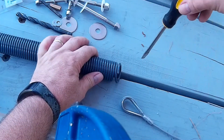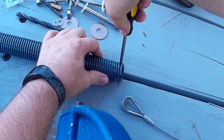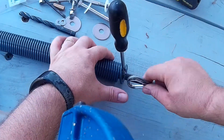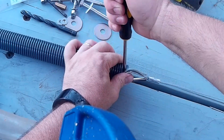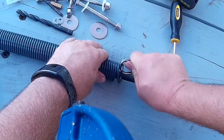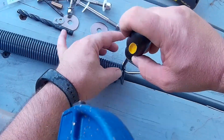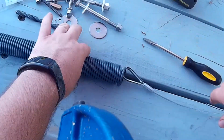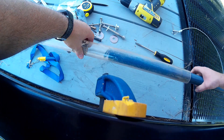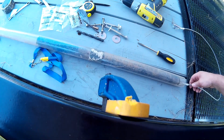Now it's time to attach the cable to the spring. You're going to have to separate this coil out using a plain blade screwdriver. Once you get it separated, take that cable and slide it onto that coil, then wiggle the screwdriver out — now you're hooked in the coil. Just take the screwdriver and pop that on in there. It is attached and secure. Now I'm going to slide the spring inside the polycarbonate tube that's going to go inside the frame rail — again, the tubing is not necessary.